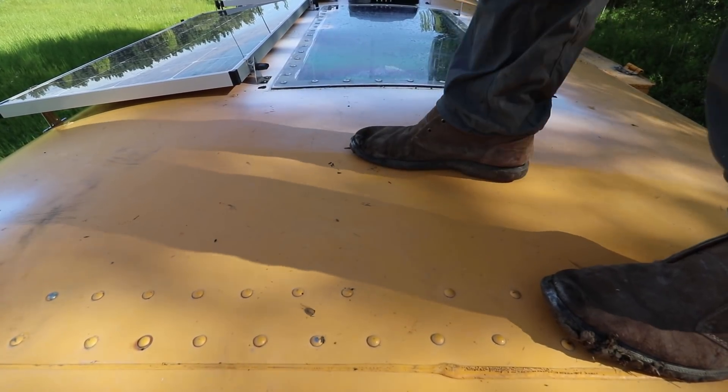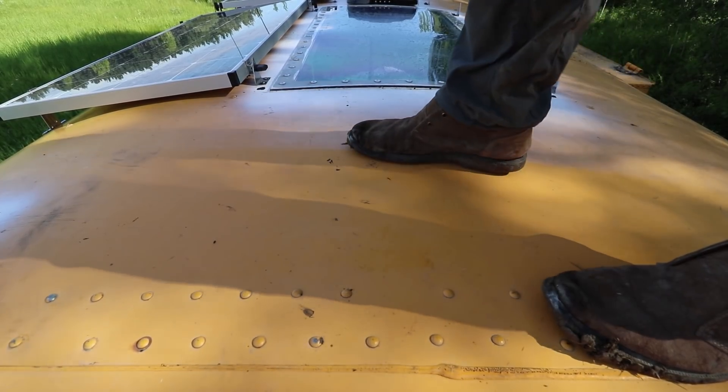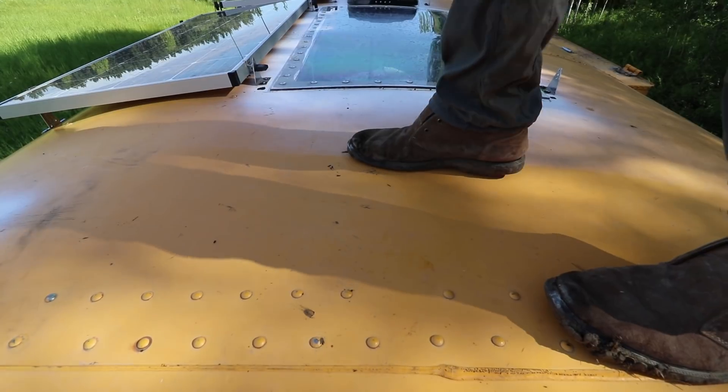There are two things that regardless of how you decide to mount your panels, you're going to want to think about. The first is your anchor point and how strong that anchor point is into the sheet metal. The second is vibration and movement within your mounts. If you're mounting panels in between two structure points, don't mount it directly in between the rib structures because that's where the sheet metal has the most movement and will cause the most problems long-term. Mount it closer to the rib structures for stronger, less flexible sheet metal, so you can drive with confidence that your panels won't pull through and fly off.